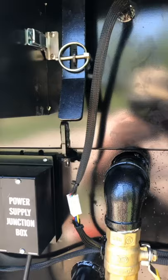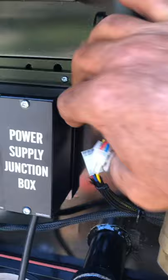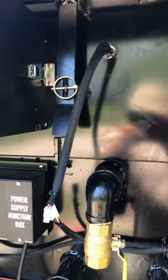They changed the handles and now it has to be snapped all the way to the closed position to trigger the switch that shuts it down. The oxygen sensor cable comes down to a six-pin plug with five wires — the extra wire runs a small heating element, because oxygen sensors won't work until they reach a certain temperature. If the sensor goes bad, the stove will still operate; you just won't get quite as high efficiency because it can't dial in the bottom air perfectly for the wood gas amount.